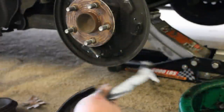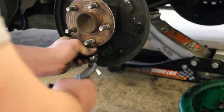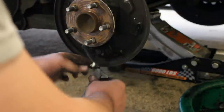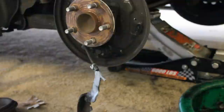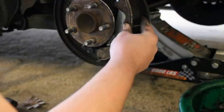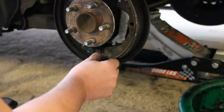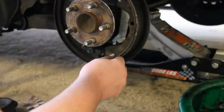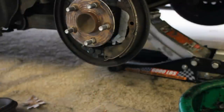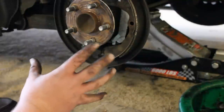You're going to take your new shoe that's connected to this piece right here. We're going to go ahead and set them back in — your cable, that's your e-brake cable right there. He comes up and twists like so, and the top sits in there. The important thing to remember is where it sits in the bottom — it sits in the bottom right there along that little notch. We'll go ahead and put the hold-down spring on and start getting springs back on, so your shoes will be set into place, and then we'll adjust your brakes.